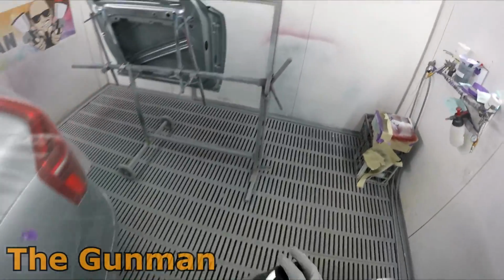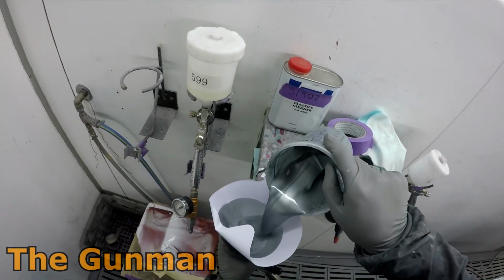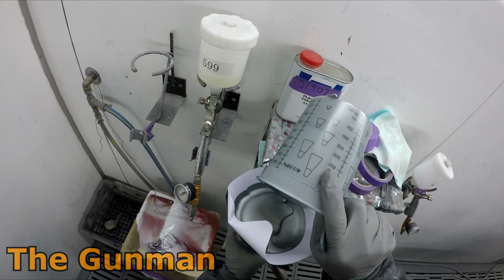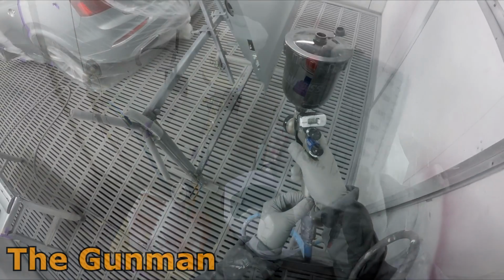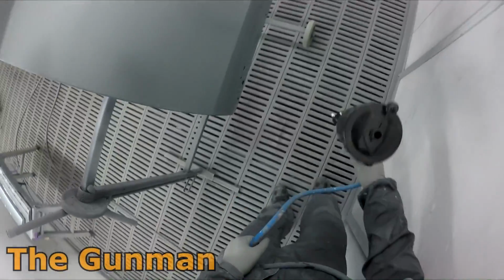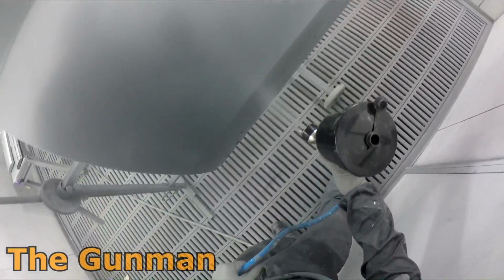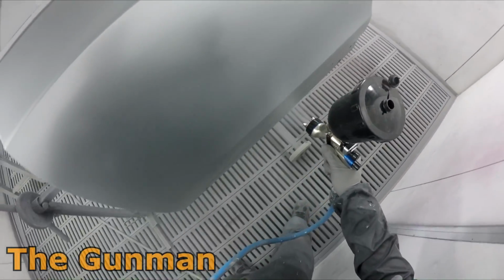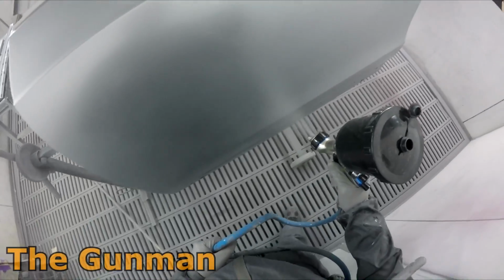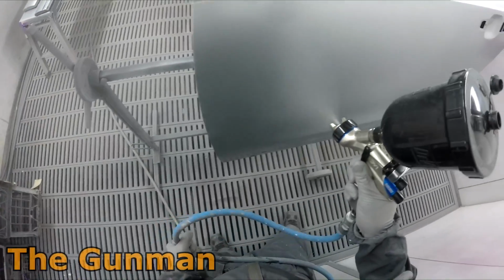I like it. It's one of those things that I've been using for quite some time. I know how to use it. There's some people that have only sprayed water, they go over to solvent and they just think it's terrible, so each to their own, I guess. But yeah, I can spray both. I don't mind spraying water. I do like the speed of solvent. You can speed the job up a little bit because flash off times are quite low. The solvents evaporate out nice and quickly.